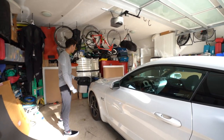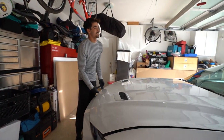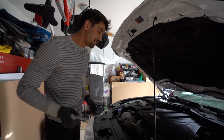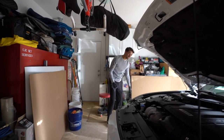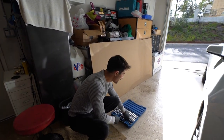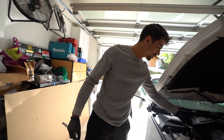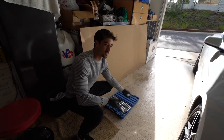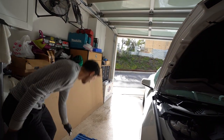I changed into some pajamas hanging around my parents' house so I don't mess up my clothes. The biggest adjustment working on this car is not having standard American-size wrenches — I have sockets but no American wrenches. Beyond that, I've just never seen a car with lug nuts torqued to 150 foot-pounds and a subframe torqued to 130 foot-pounds — that's pretty wild compared to what I'm used to. No more hand-tight stuff on this car.